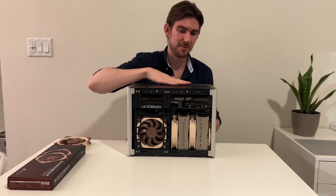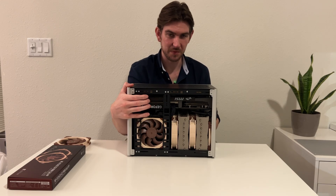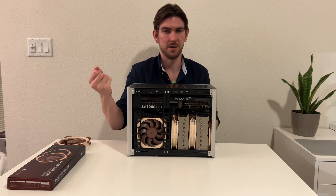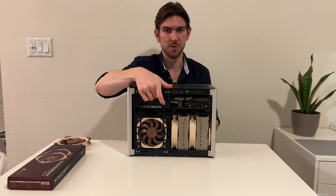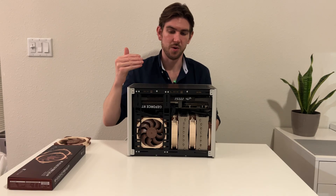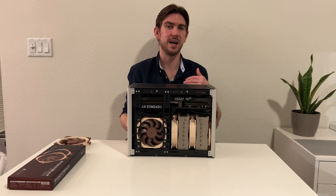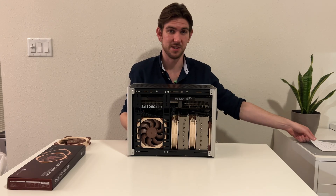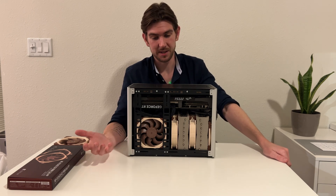When I added these 15mm fans — in my original video I had a Zotac Solid OC 5080, but I broke two of them when the locking tab on the 12-volt high-power connector snapped off twice, so I ended up going with an MSI Gaming Trio OC. I have enough room with that card and I added the 15mm fans. The GPU temperatures went from 72 on average with highs of 77 Celsius down to 68 to 71 Celsius — a four to six Celsius difference, which is quite impressive.